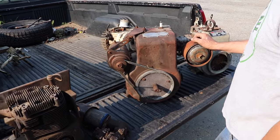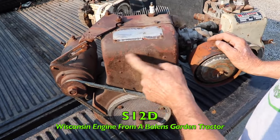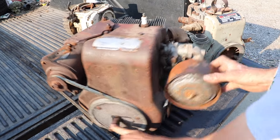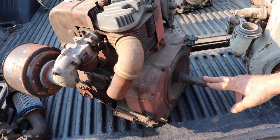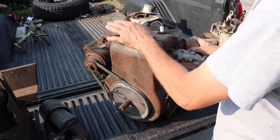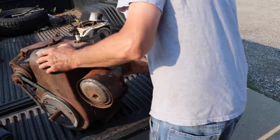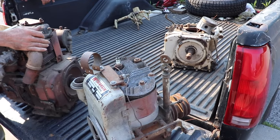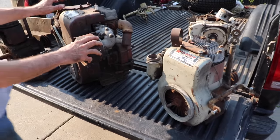This one here, this is an S12D. This was probably on a Bolens garden tractor. This was for the drive shaft. And here's your PTO. This one I might be able to get running. This has got points and condenser in it. That white engine has the same setup on the crank, but... Oh, that one there? Yeah, pretty close. Well, let me take a look at that one. But this one here, if I had a coil,